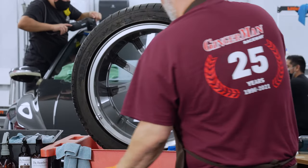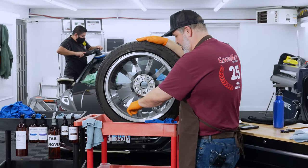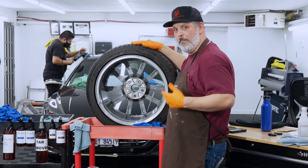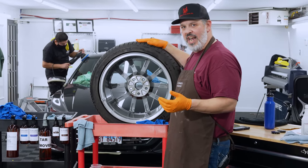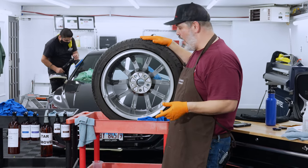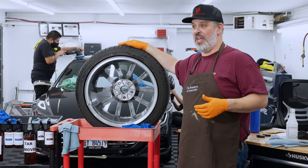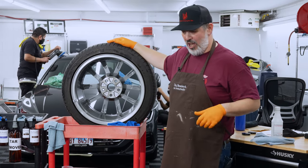Once panel prime has completed breaking down all the contaminants — you can see all that brown gook trailing up here — I'll come back with the pH neutralizer, our buffer. That serves two purposes: it brings any residual alkalines back to a pH of 7, and it removes caustic chemicals from the surface before we coat it.